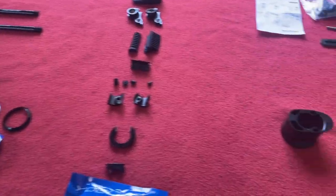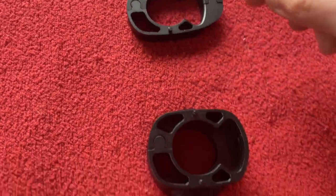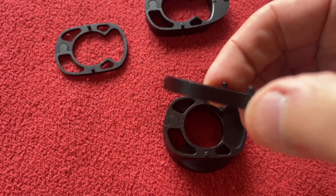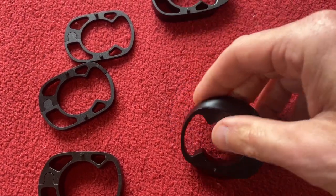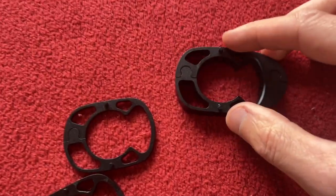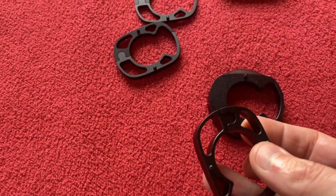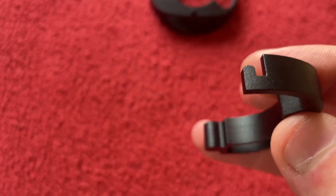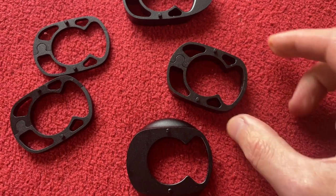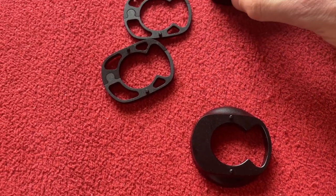I'll open up all this paperwork stuff and see what we've got. In this bag we have a range of goods. Starting with these — the spacers for under the headset in various sizes. We have one for underneath the stem itself, that looks like 10mm. So we've got a 3mm, a 5mm, a 10mm, and the actual one for on top of the bearing that sits on the frame. They all interlock — the little nodules fit underneath the handlebars to lock in place. They split apart so you've got a ball on one end and a hook on the other, and you just put them into each other so you can easily add or remove them.